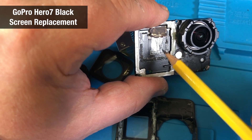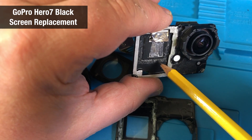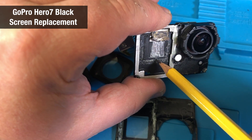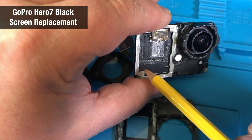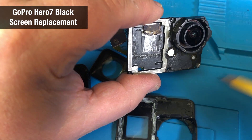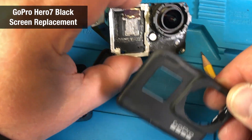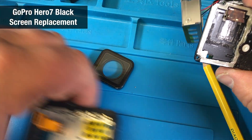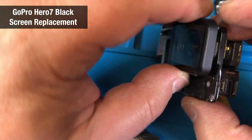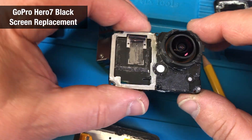There was heat transfer tape underneath. I don't know exactly how I'll fix that, but I will somehow. There needs to be some heat transfer material here. This glue area also has to come out because the new display will be glued in, and if anything underneath isn't super flat, it will crack. Be careful with those corners — they break easily. The front is going to be damaged and has to be replaced for sure.